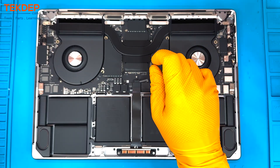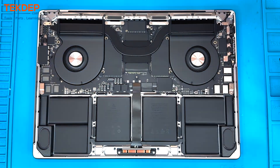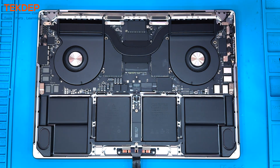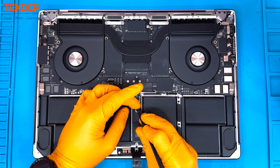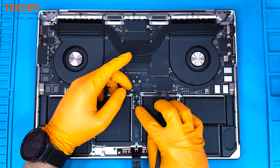The first thing we're going to do once we're inside the machine is grab our T5 screwdriver to remove this little cover that clips in the trackpad. Then we're going to peel that cable away and unclip the battery module flex cable — this is what tells the battery what charge it's at, when it should be charging, when it shouldn't, basically just relaying information to the computer.